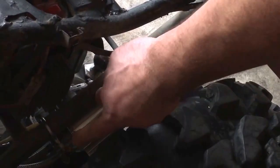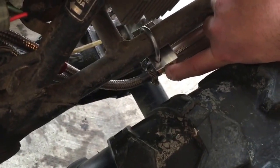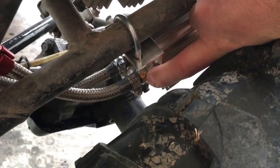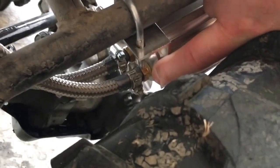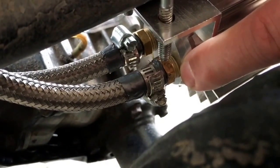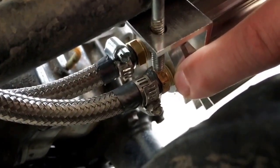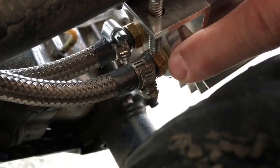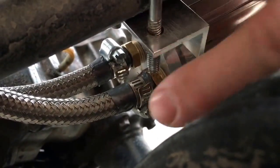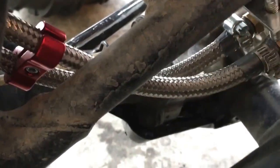This oil cooler came with some fittings — AN6, or 'six AN,' that's the size of the barb tube fitting. I needed AN4, so I took my AN6 fitting — NPT pipe thread on one end — down to Ace Hardware. The guy said, 'You want quarter?' and I said yeah. He said quarter and AN4 are pretty close to the same thing, so that's what I got and they worked fine. Next I ordered braided hose line — AN4 or quarter-inch stainless steel braided hose to fit that.